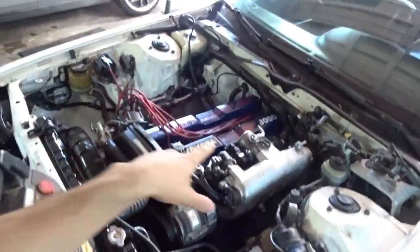So the battery was fully dead from me trying to start it. I went ahead and started it without anything hooked up so I could cycle the oil, and that's how I killed the battery, because I was doing it for so long, because I put oil in there obviously because it was bone dry. So now I've had it cycled and the charge starter pack should be charged enough, so I'm going to try to start it. And I keep hearing popping out of the intake, and I'm pretty sure that's because the spark is not going correctly. So we're gonna figure that out right now.